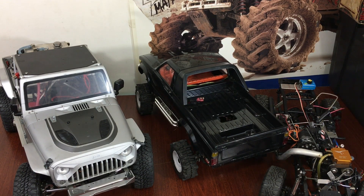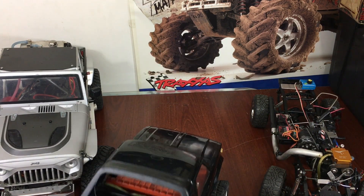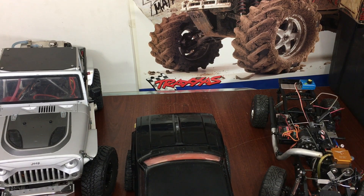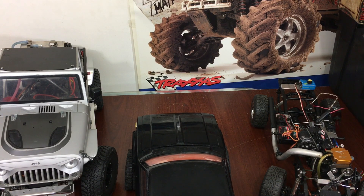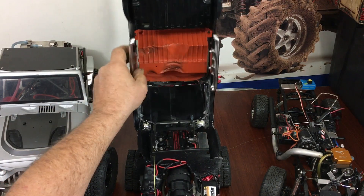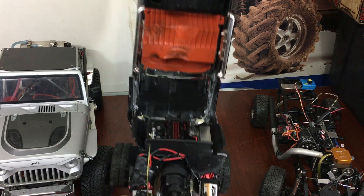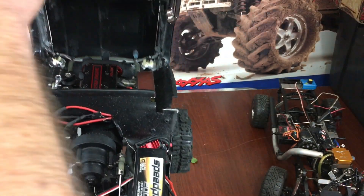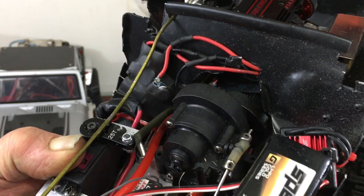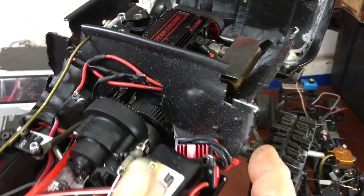So far the Kyosho Nitro Tracker transmission is working out pretty well in this thing. You can see how I set this up in here - I did the video and you guys probably seen some of that. I'll go over a little gear ratio stuff so you'll be able to figure out what you can use from your junk box or what you need to order if you want to build one. You can see it just sits right in there nice and small, and then I've got a little jack shaft going to the transfer case. My forward-neutral-reverse is right here and the two speeds are here.